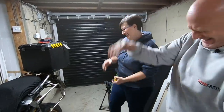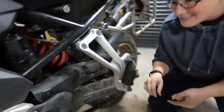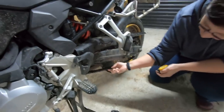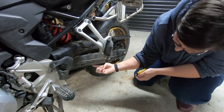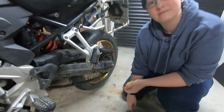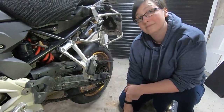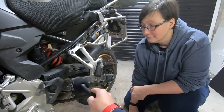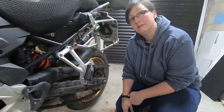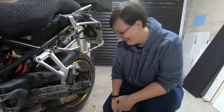It says right here on the swingarm — 40 to 50 millimetres is what it should be, and this is significantly more than that. But the principle is straightforward: you're measuring from the bottom to where the slack finishes. If it's over the tolerance — too slack. If it's under — too tight. Adjust it until you've got the tolerance they specify. It really is that simple.